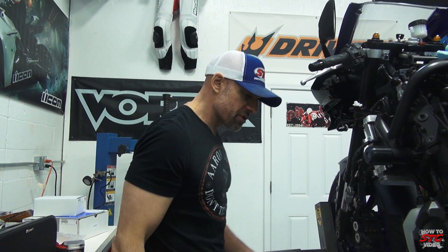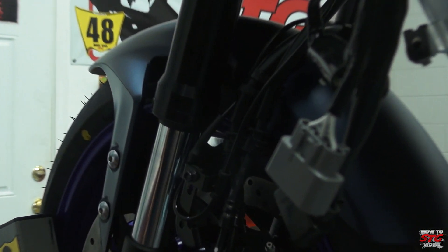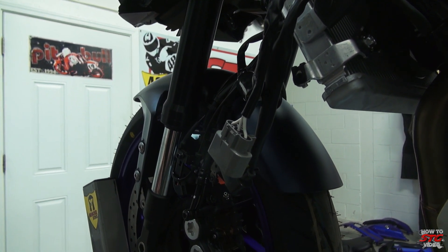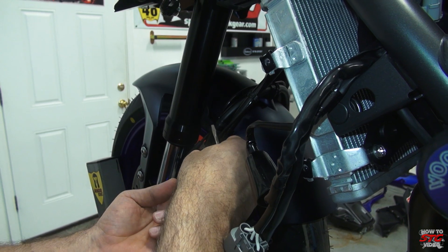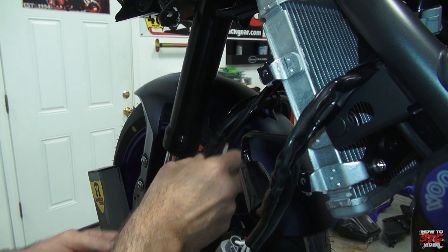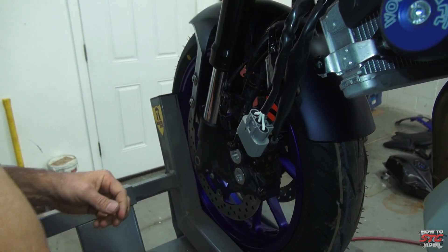The system is drained and we're ready to start removing the front brake lines. Have cleaner and rags ready to catch any stray brake fluid — the stuff is really nasty. There are a lot of clips holding the front wheel speed sensor wiring harness onto the brake lines. It routes down, loops over the fender, and the wheel speed sensor is on the right side. To spread the larger clip apart you have to pull one tab on the top and one on the bottom while applying outward pressure.